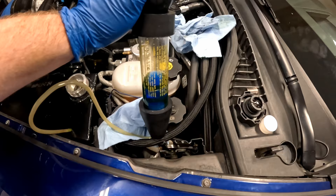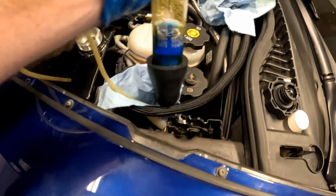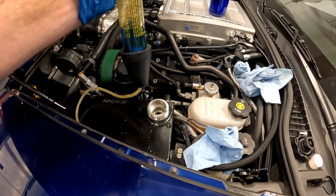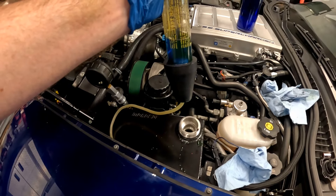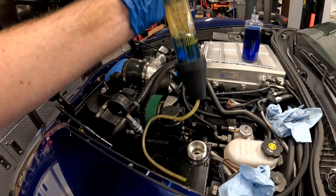Alright guys, we have this combustion cooling tester kit I got on Amazon - delivered overnight. The goal is to see if we've got combustion gases in the coolant. I've got this little straw here, but unfortunately the rubber triangular shape won't fit into my coolant cap, so we're going to do it kind of remotely. You basically fill the tester with the blue fluid, put that in the reservoir, and draw air through to see if it changes color - from blue to yellowish - indicating combustion detected in the coolant.